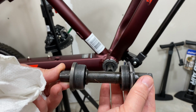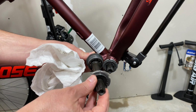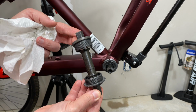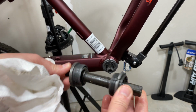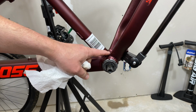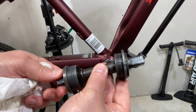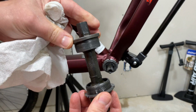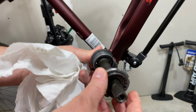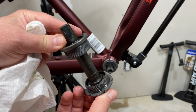But this is what is together here. Down in this bottom bracket, it sits literally just like this. So sandwiched inside here, and this tightens in. This bottom bracket's threaded, as you'll see when we remove it. This is threaded. And you can see these are threaded. And they tighten in on both sides, tension together, and then it's locked in place with this lock ring to keep it from coming out.